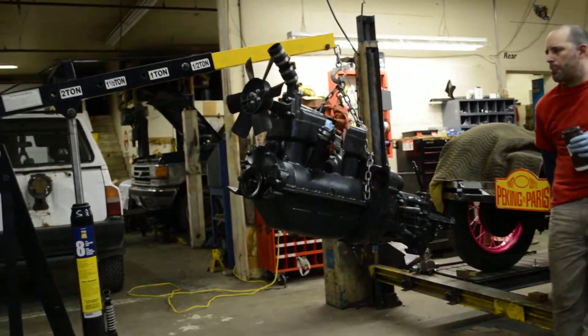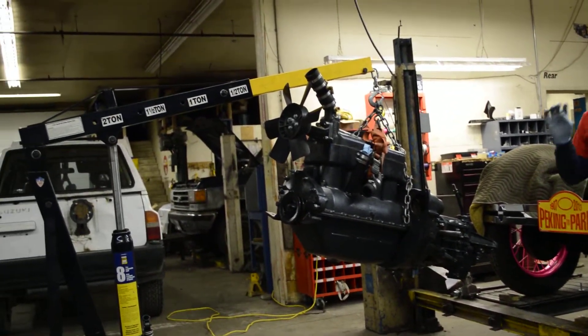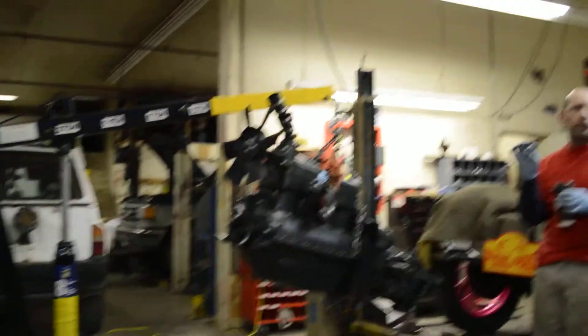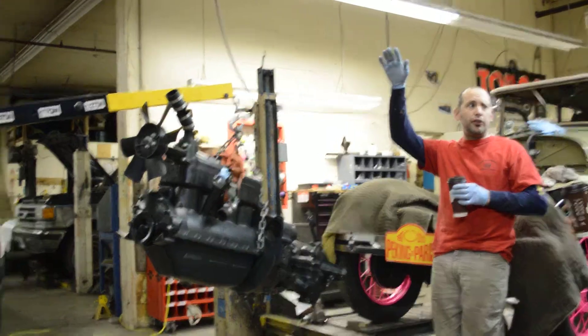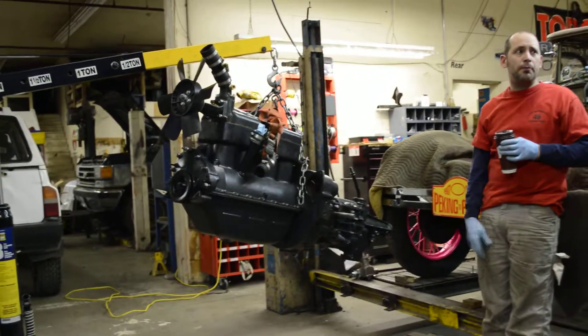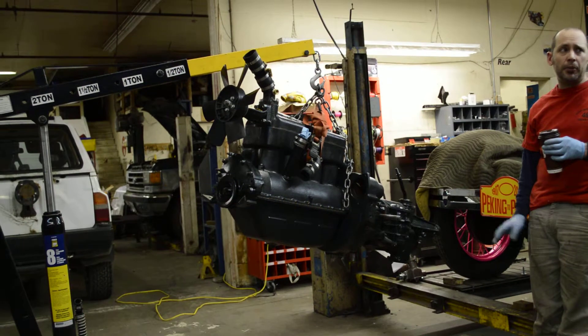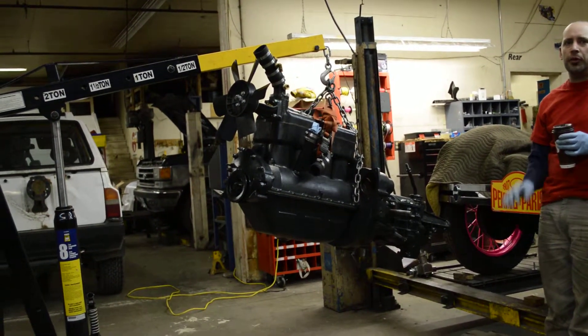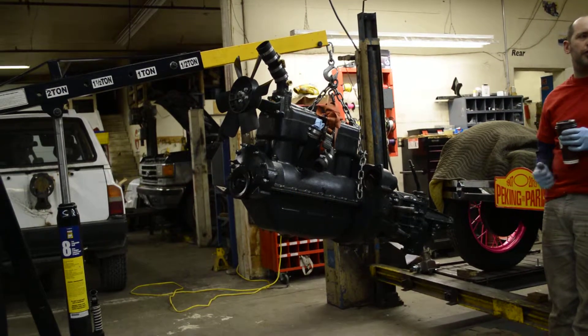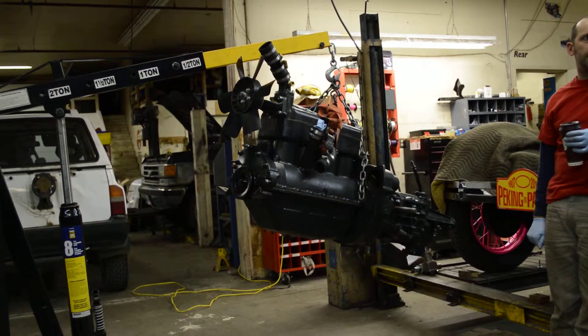It makes it look pretty tiny, but that's the one you're going to want to change with driving conditions too. Like up in the altitude, you're going to want to leave it back a little bit. You might even have to muck around with the carburetor a little bit. Not like you want to change jets or anything like that — it'd be very fine adjustments. Quarter turn here, quarter turn there, that sort of thing.